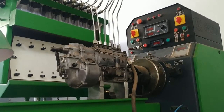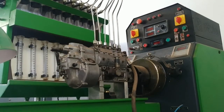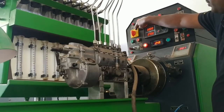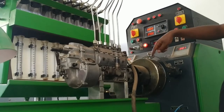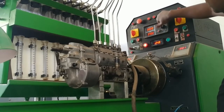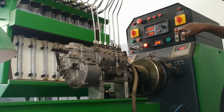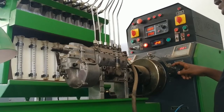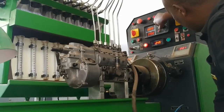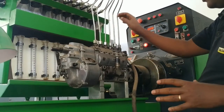We are doing the test on this six-cylinder inline injection pump. We're going to see the amount of fuel being delivered here. This is the main motor switch, this is the fuel supply switch, this is our tachometer that will measure the RPM, and this is the timer for fuel delivery — the number of shots will be adjusted here. RPM can be increased or decreased here. Let's set the number of shots to 1000.